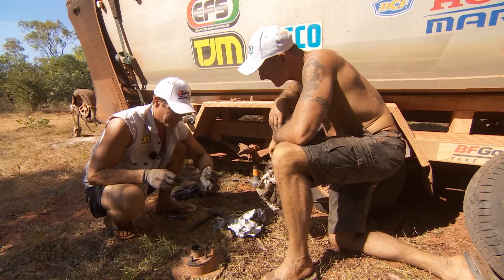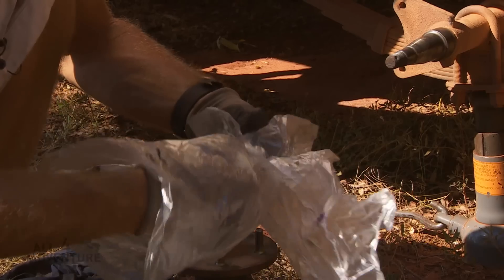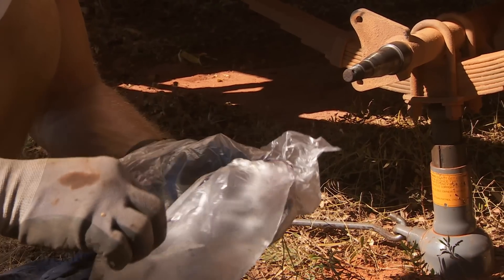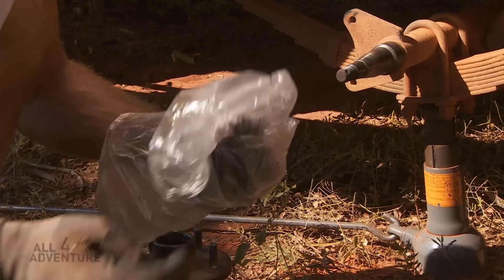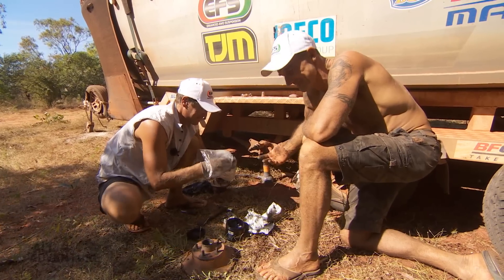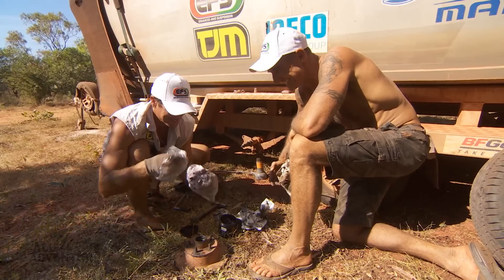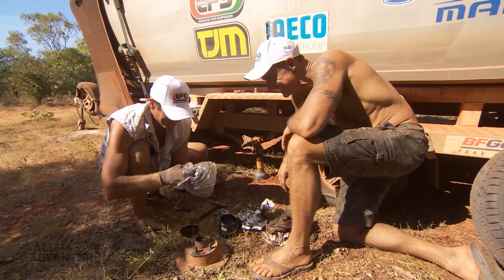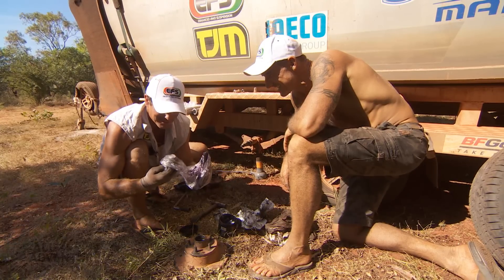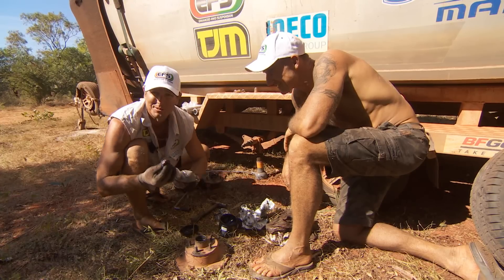What I might do is whack a bit more grease into these, and I'll show you a little trick that I learnt to make it easier to pack your bearings. Now these are just freezer bags. It's working well — it's real magic to keep your hands clean. You know, you'd be covered in grease otherwise. There we go, that worked really well.